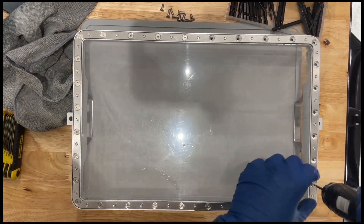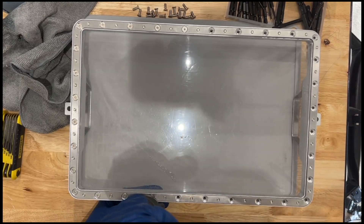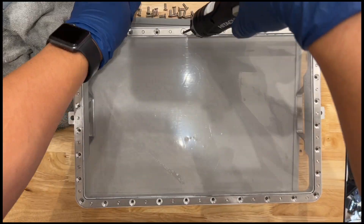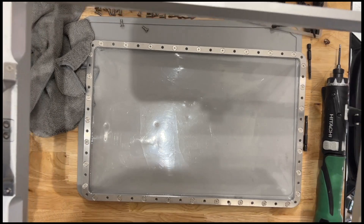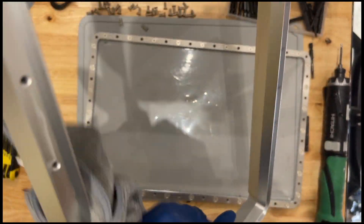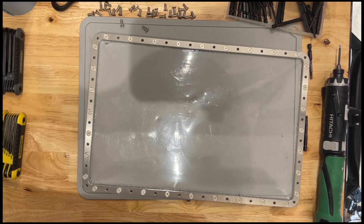Keep in mind, you'll notice I'm wearing nitrile gloves because there is still resin residue on the vat bay — I don't want to get that on my hands. We're going to have to do some cleanup once we get this off, cleaning the seams around the inside of the vat bay to make sure we don't have anything there to disrupt the seal. We don't want that seal to get disrupted and have another leak, or any particulate to get in there.